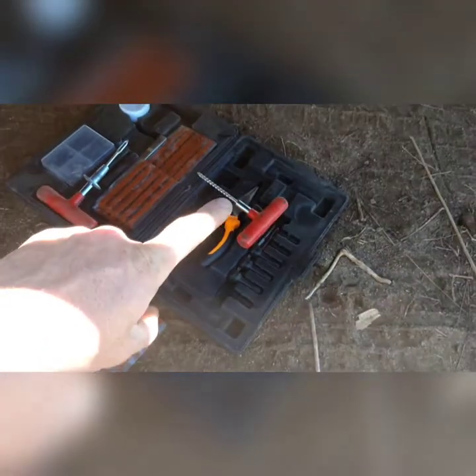So with a screw like this — I know this screw is about an inch and a half long because it's coming from one of my job sites. I'm going to use this screw gun to back it out, and also I'm going to run the screw in reverse to try to ream the hole as best I can, because sometimes putting that tool in a hole that's pretty small can be difficult. So I'm just going to use the screw to do most of the work for me.